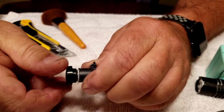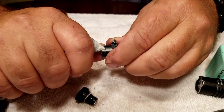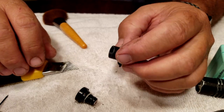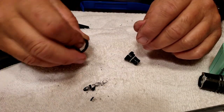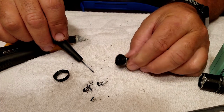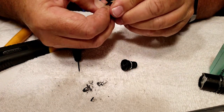I didn't get all the glue off, but I got it to where it would break free and got the lens to where it would screw out. I'm realizing the lens looks a little different from any I've seen before. On the GoPros and SJ Cams they all use a 12mm thread size — I measured this one with calipers and it is 11mm, which means you can't just go to Amazon or eBay and buy a new lens. The fisheye lens that was busted — I took the cover off and it just collapsed and fell out, but the inside of the lens was actually fine, which gives me hope of repairing it. The cover I snapped off revealed the fisheye lens had just shattered.